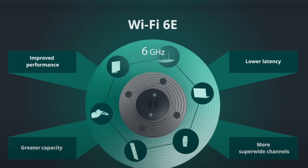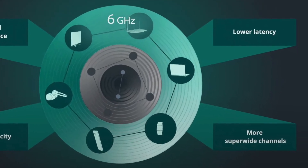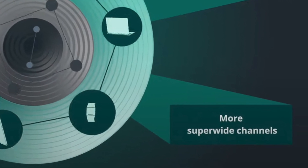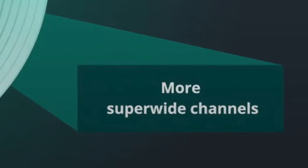Wi-Fi 6E is important. We already know Wi-Fi 6 is the standard, but 6E takes it further. On top of the 2.4 and 5 GHz bands that most routers have used, you now have a third band at 6 GHz. Any device that is Wi-Fi 6E compatible will connect on that band. That band also opens up extra channels, which matters because congestion can occur — not just from your own devices but from neighboring Wi-Fi networks as well. Wi-Fi 6E helps clear that up.